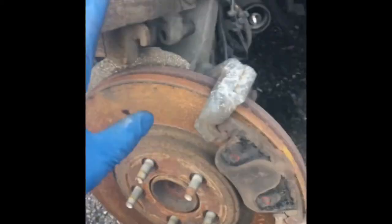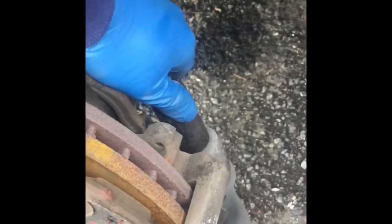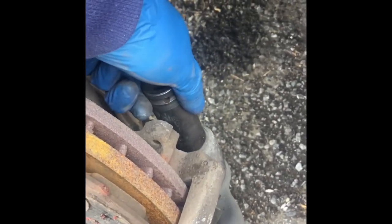Back with the update. I wanted to mention I might as well go ahead and take the brake caliper off, which is going to be a number eight — a hex, or whatever you want to call it. It's a number eight, goes in, fits perfectly. Little bracket off the front holds the caliper in place. Take that off with some needle nose pliers, then you take the caliper off, and then you get exposed to this bolt right here. It's a 22 — feels like it fits perfectly. So let's go with the 22.